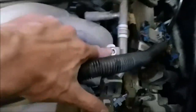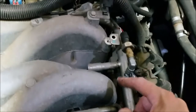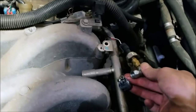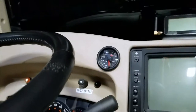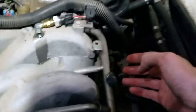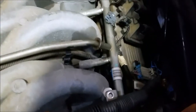I'm just about ready to pull the injector. All you need is a 10-millimeter deep well socket to get the two screws loose. I also sprayed a little PB Blaster down around the O-rings of each injector, then grabbed each injector and twisted it slightly in the bore to break the seal. Also remember to release the fuel pressure — you've got like 50 or 60 PSI on the fuel rail. I've got a sending unit so I loosened that up. I'm about ready to lift up the fuel rail now.